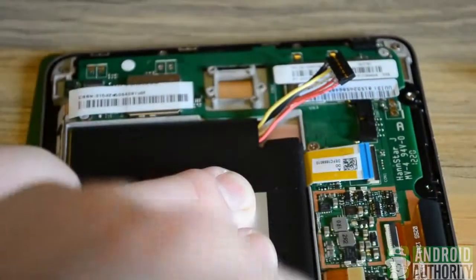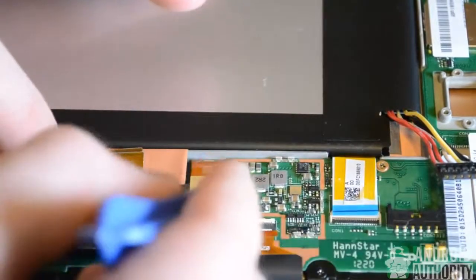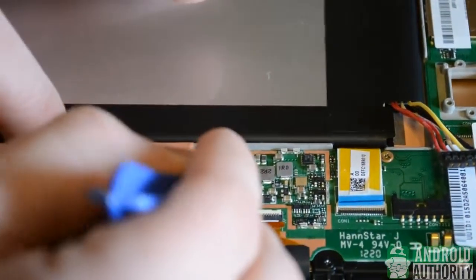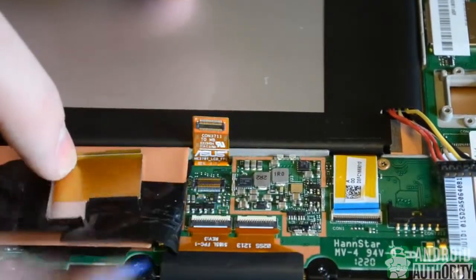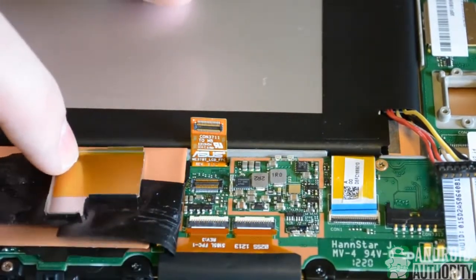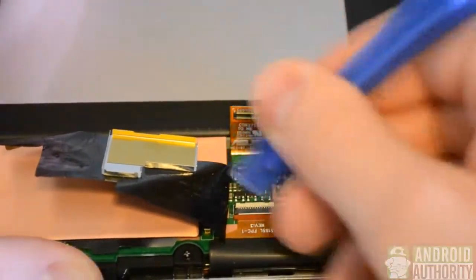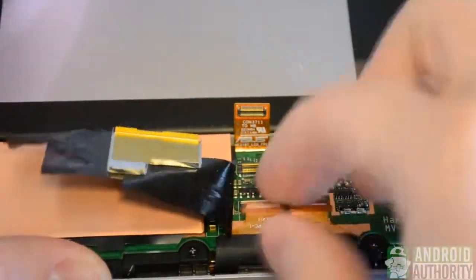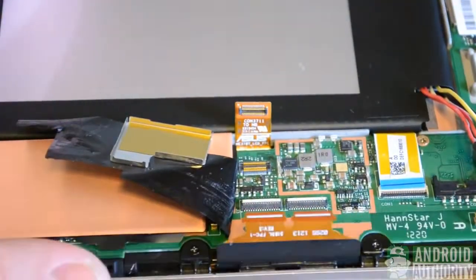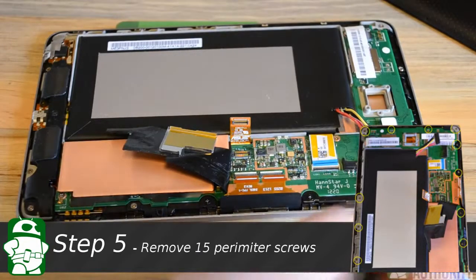If you happen to lift up the small metal cover that covers the components, that's not a worry — you can leave that aside. Next we will work on removing the LCD display cable. We're just going to work our little spudger under the cable and pry upwards, which gives fairly easily, and then we can move it out of the way. We'll then work on the two other ribbon connectors, which have pressure clips that we can lift up from behind. We simply pry upwards on both ribbons and slide them backwards.